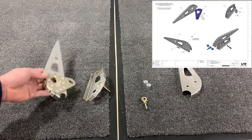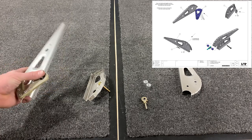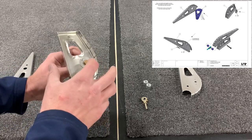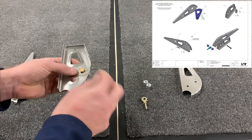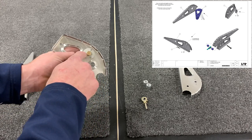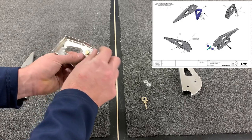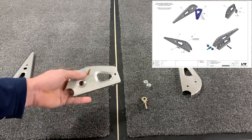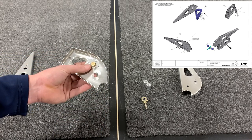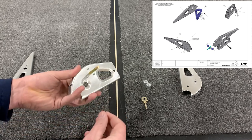Rib 2 is fairly straightforward — just use 4.8 by 10 millimeter rivets to secure the hinge bracket in place. For rib 3, I find it's best to slide your AN416 bolt through the hole first, then use two clecos and just match drill and rivet, match drill and rivet, because the plate may not line up exactly with the two holes. That would require clear-drilling it with a quarter-inch drill bit, which is an option, but doing it this way makes sure everything lines up dead on with the hole ahead of time.